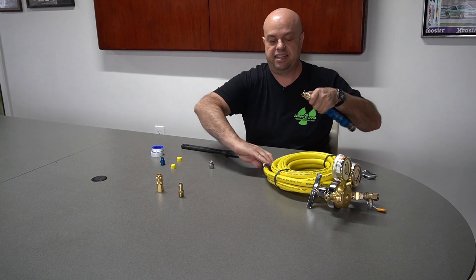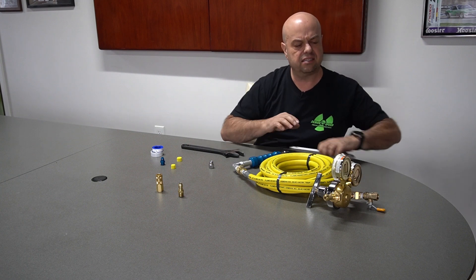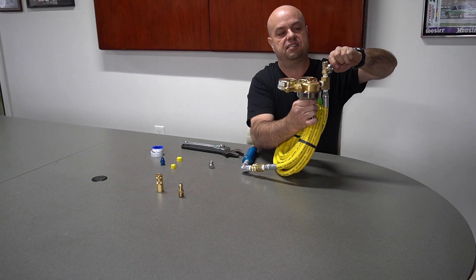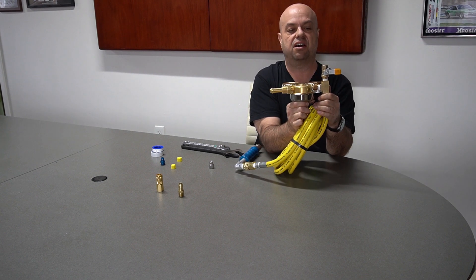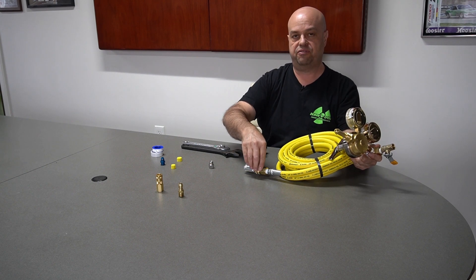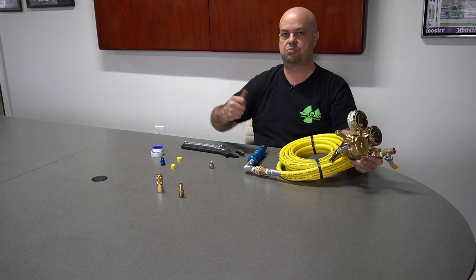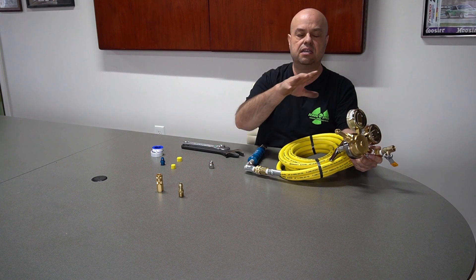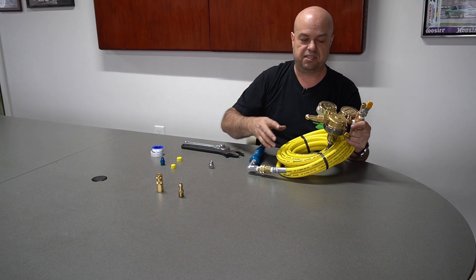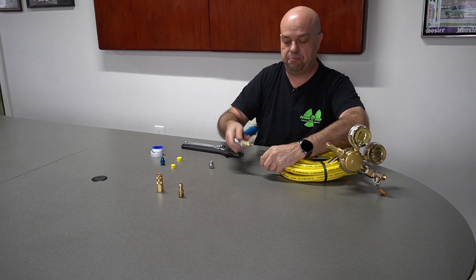You now have your completed hose assembly. This connects by pulling back the collar, sliding it in, and there you go. The valve on the hose assembly needs to be in the closed position when shut off. The reason for its existence is that you can't decouple the fitting when there's 500 psi of air pressure on the hose. When you want to disconnect it from the car, you need to purge the nitrogen out of the hose by opening the valve — with the tank off first — then close it again and the fitting will pop back apart.